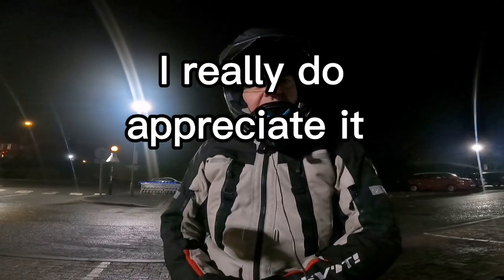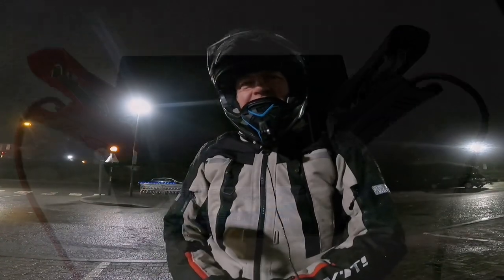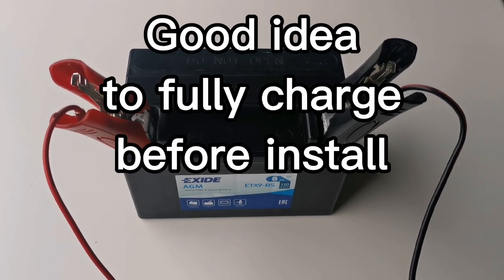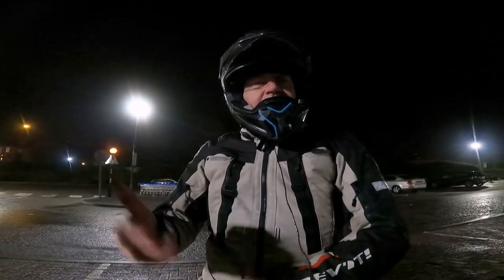I really just want to say thanks very much to everybody who gave their advice and input on batteries and checks on the bike. I've been out here for about an hour and a half — really just to let the battery know it's time to wake up, because this is the time they really activate. That first run, you don't want to just leave it ticking over for 10 minutes; get out and give it a good half hour or an hour, get up and down the bypass, really warm up the new battery cells.